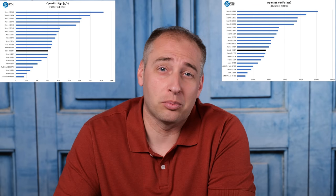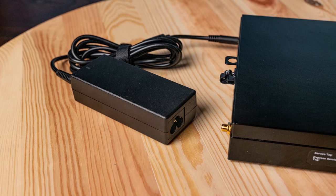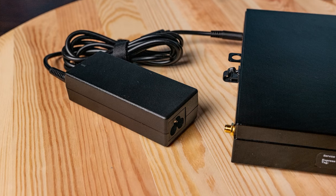Because it's a lower-powered part, that means you can use a smaller power brick — a pretty standard little Dell 65-watt power brick that's small, easy to hide anywhere, doesn't take up much space, and they're really easy to replace because Dell sells a huge number of these every year. Typical power is what we've been seeing in most of these units — basically in the 9- to 12-watt range idle with a hard drive. With SSDs, you're going to see that idle stay pretty low, and in terms of typical usage we saw maximums in the probably 40-watt range pretty commonly.